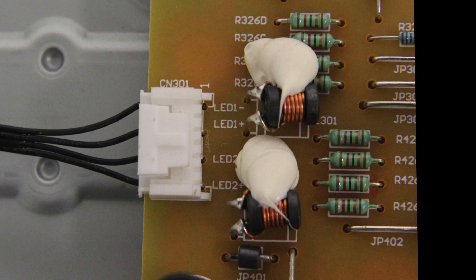The test points are broken into two separate groupings, LED1 and LED2. Most TV panels will have an even number of LED strips in them, which means the voltages should be identical at the test points. We have about 40 volts per strip in each group, so LED1 and LED2 should be around 120 volts each. My test points on the power supply at the LED connection will be labeled as LED1 plus and LED2 plus.